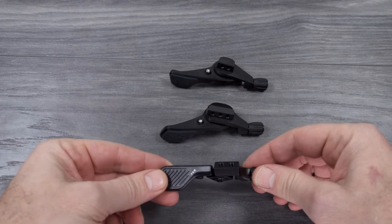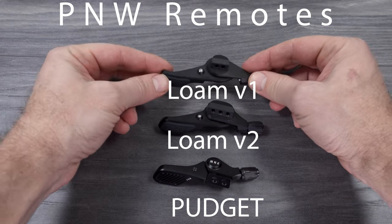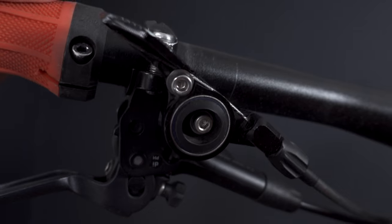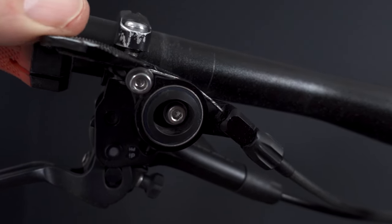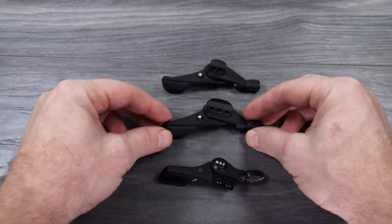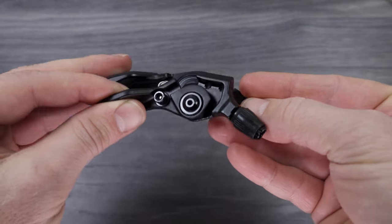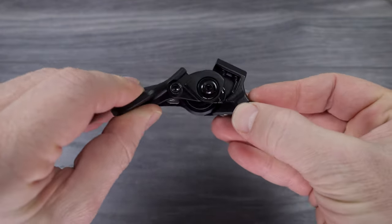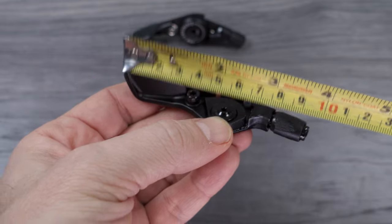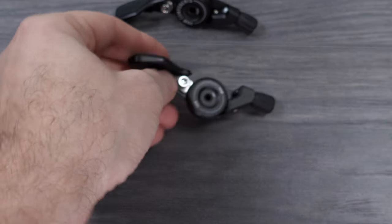Here's the lever lineup with the Puget at the bottom, followed by version 2 and version 1 of the Loam lever. The one huge difference between the Puget and the other two is what makes those two levers very similar to the good old Wolf Tooth: the big sealed bearing they pivot on, as opposed to the Puget which just has a small pivot that is pretty tight right now. Bearing or not, they pivot around the same point so cable pull should be the same. The lever length from that pivot point is just over 2 inches, or 52–53mm — pretty much the same on all of these levers.